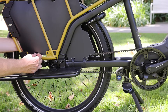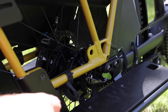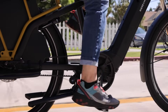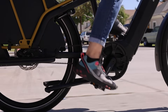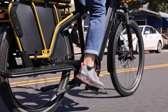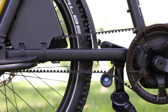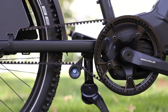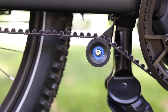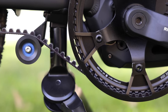This particular version is the GT Rohloff HS, meaning it has the Rohloff hub — their top-of-the-line drivetrain. It's a 14-speed internal hub with electronic shifting, a pretty unique system you won't find on many bikes. Riese & Müller offers it on most of their models, and it gives you a very wide gear range — very low for climbing large hills and a high gear for maintaining speed. There's also a belt drive, which doesn't need to be greased or lubed and lasts significantly longer than a chain. You can also get the belt drive with the Enviolo Vario, a continuously variable transmission.